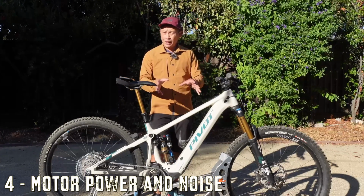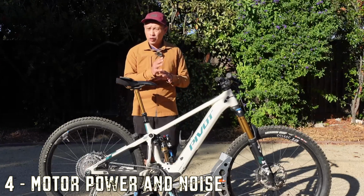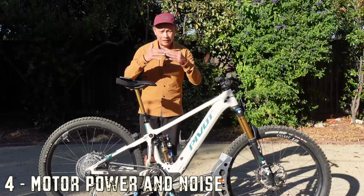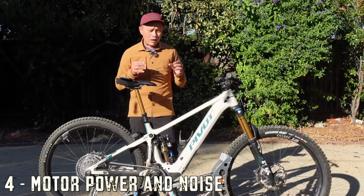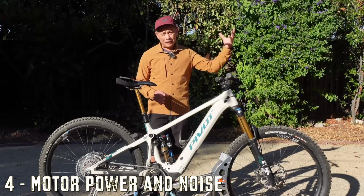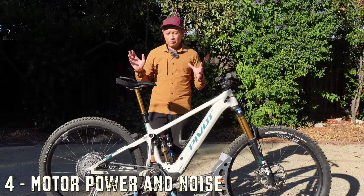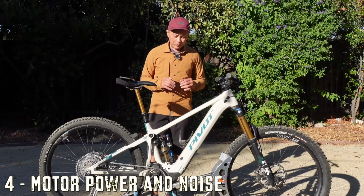The turbo or the race motor, which you pay, I think, $1,000 extra for, doesn't show a big advantage there, because those are capped in the wattage and the Newton meters anyway. So you're not getting extra power with this motor. Most of the race mode advantage is in the firmware, how fast it comes on. So in my particular case, it hardly makes a difference. But this does beat the Gen 3 Levo, a brand new Gen 3 Levo that I just got. This is a little faster. They're fairly close.